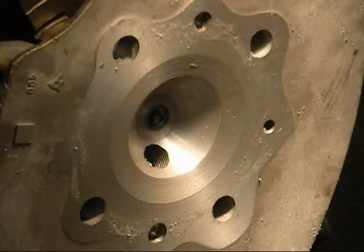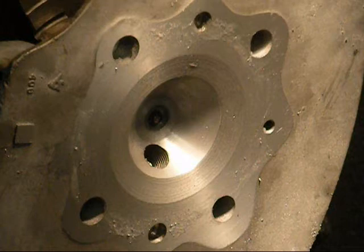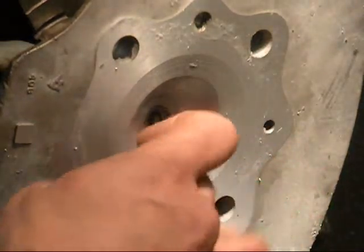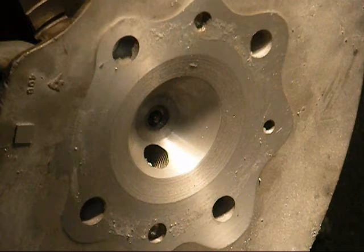This has been in and out of the lathe a couple of times, and the moral of the story is I'm right where I want to be. I rounded it at 24 - it was actually 23 and three-quarters cc's, so I'm right on the money there. I'm a little bit small, but this has an auxiliary spark plug in it that we're not going to use, and that spark plug sticking out in here is taking up room. So by backing it off and doing that test, I got exactly where I want to be.